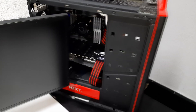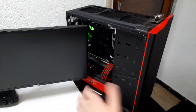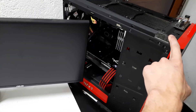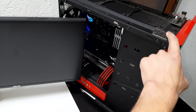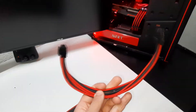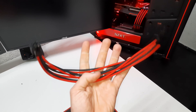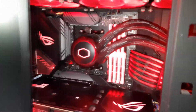Okay, here we are at the first boot moment. Let's see if it's working. I didn't put everything together because I don't trust myself, and I think it's not really working. But — see, that's what I'm talking about. Okay guys, I finally got everything to work. The problem was one of those sleeved extension cables was just broken, so that one cable almost messed up my whole build. I twisted the radiator around and everything is working now — the fans and my LED strip as well.